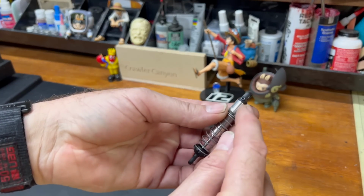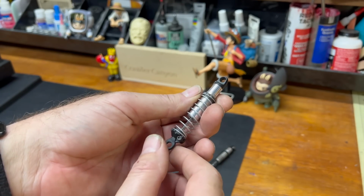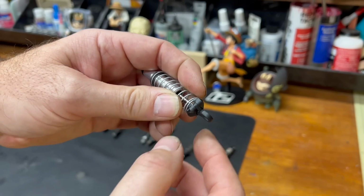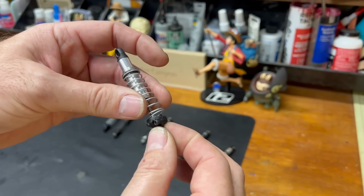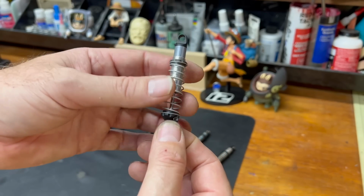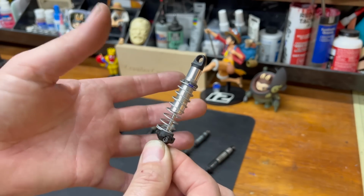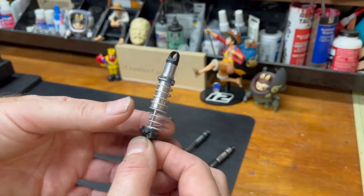We've got a cap that threads in, but it's got a bleeder cap. We've got probably the best clamping, because you can see there the actual rod end has a little tab. They're not just clamping, they're actually bolted together, which really helps. And if your spring fitment is tight, this is a stock Incision spring, you don't have to worry about this kind of stuff happening. And that does happen because we often overextend the length of the spring.